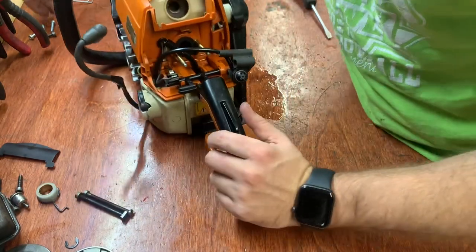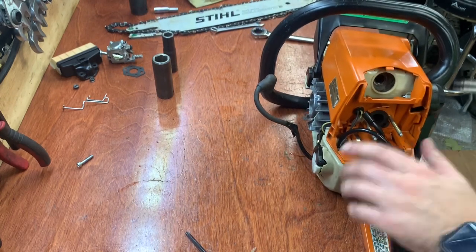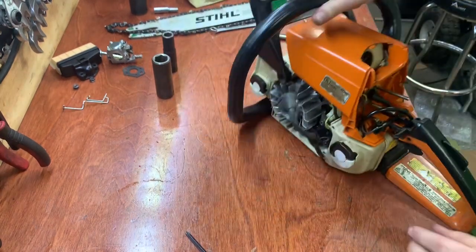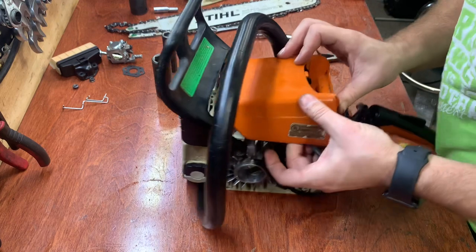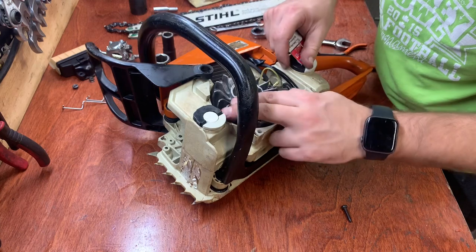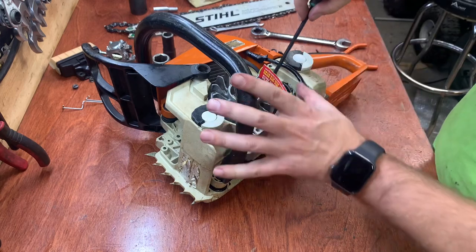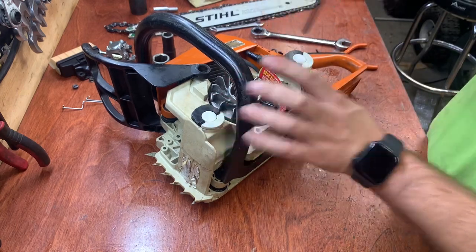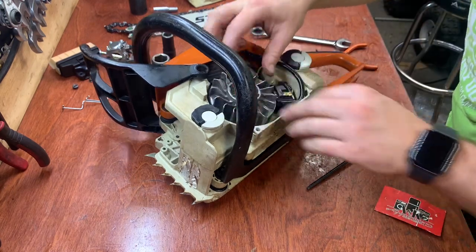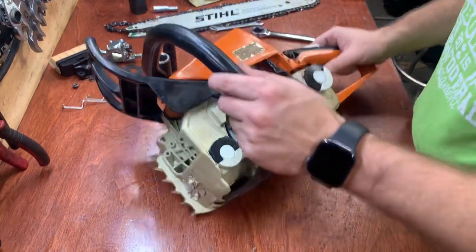We've got the handle screws next. All right, handle's back on. All right, let's align this coil correctly. Use the old business card trick. Pull that out, so now we're not hitting and it's moving nice and close. So you can always come back and adjust that later. For now, I'm happy with that.